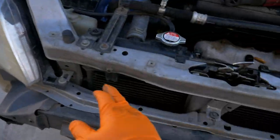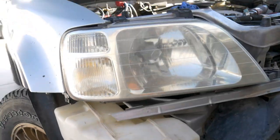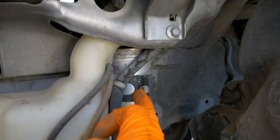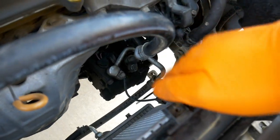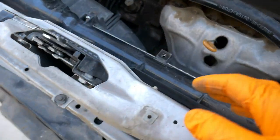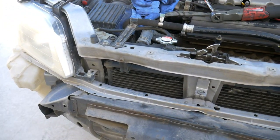Removing the bumper is a cinch — just four Phillips head screws, one on each side and one at the bottom on each side. The bumper cover comes straight off. We have full access, which we need because the receiver dryer is held in by this bracket. I also removed the fan — very easy — and now there's so much more room to get to the compressor. I'm hoping I don't have to change the condenser because I'd need to take all these brackets off and possibly drain the coolant and remove the radiator. We'll find out.